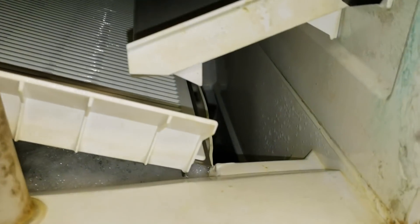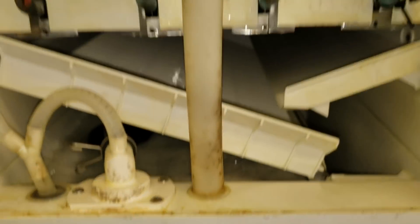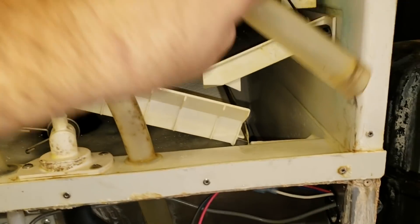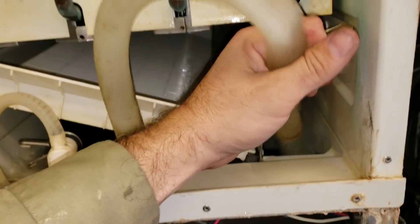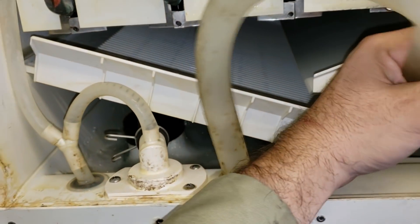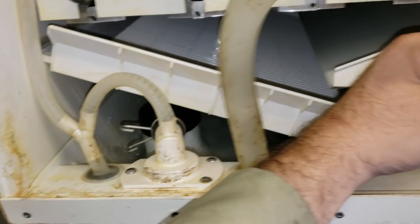If you need to drain these things quickly and the bin is completely empty, like in my case, and you want to drain out all the cleaner — just pull off the pump hose, hold it very carefully, make sure all the clamps are run, and then turn the pump on. It'll pump out all the water. You don't want to let it cavitate for too long and run out of water, but that's the quickest way to pump these things out.